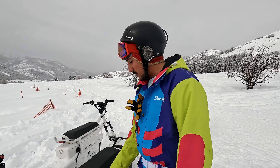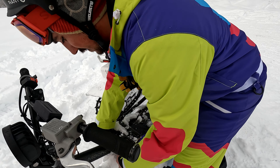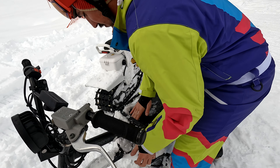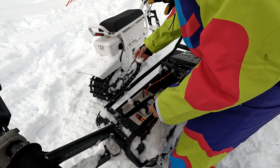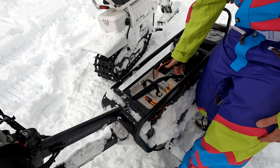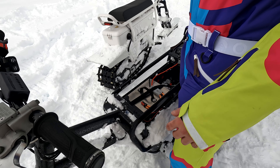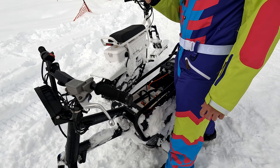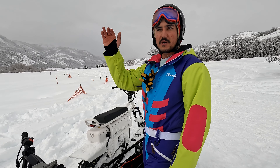With the thumb on the throttle you're riding for an hour and a half. You can fit two batteries in there to get up to three hours. There's always the fear of cold affecting the charge capacity, so the battery box is heated to make sure that doesn't happen. You can get into temperatures of negative 15 degrees. When you're done riding and you want to recharge, there's a handle on the battery that makes it really easy to remove — just unplug it, take the strap off. It's about 30 pounds, so you lift it out, bring it inside, and the charger plugs right into your wall outlet. It charges in about four and a half hours from zero to 100.